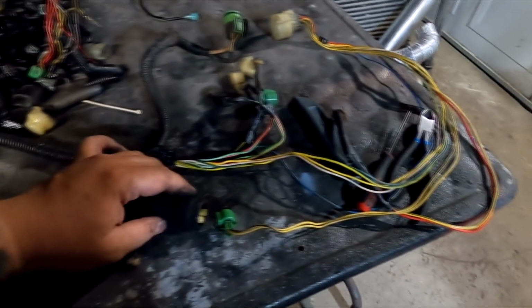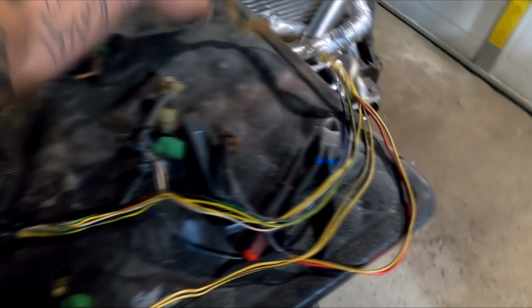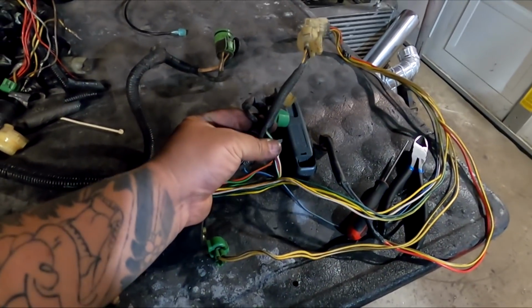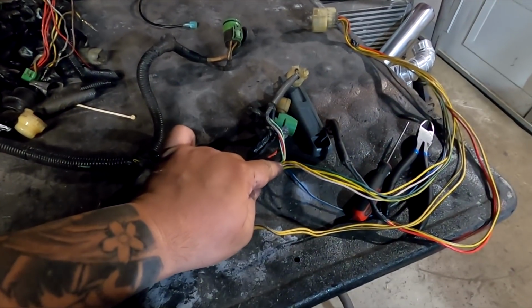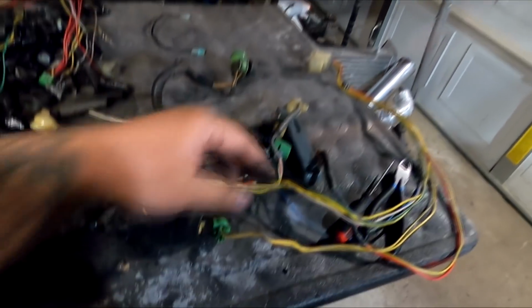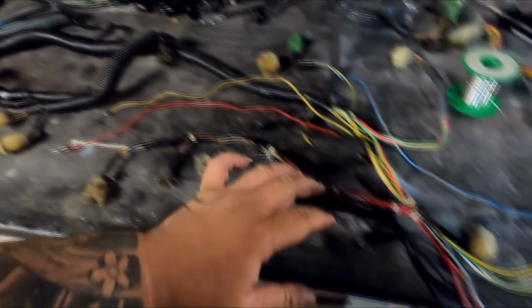But that's out, and again, I'm gonna go ahead and get the injector harness in place, which typically I should have shown you guys this. So all these wires are bundled up right here. I mean, you'll see if you're doing this yourself. From this driver's side plug, you're going to get to this bundle of wires right here. Typically, this is where the 4 injector harness sits, because this point right here normally sits around the driver's side intake manifold, and then the injectors start right there, literally right next to this joint. So 1, 2, 3, 4. I'm gonna put the injector harness right there, zip it in place, and then we'll continue with all of these other guys. So I got the injector harness in place. I'm missing one clip, but I'm probably gonna yank it off that harness as well too.